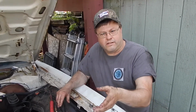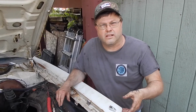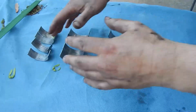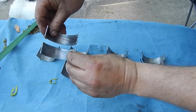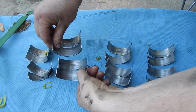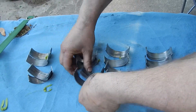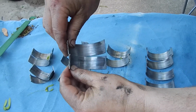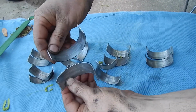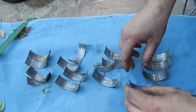I'm done with the job now, and I'll show you the rod bearings that were in here. Let's go over that way. You can see the back of the engine, the bearings look the worst. The rod bearings in the back. On the back journal, the next 2 were better. Still see some brass and some scuffing. As they come forward, they look pretty much like normal wear. And when you got to the front, they probably didn't even need to be replaced.